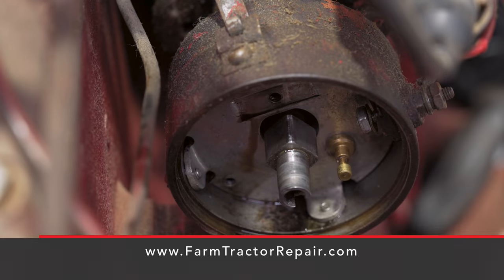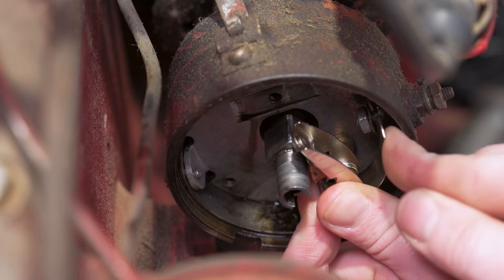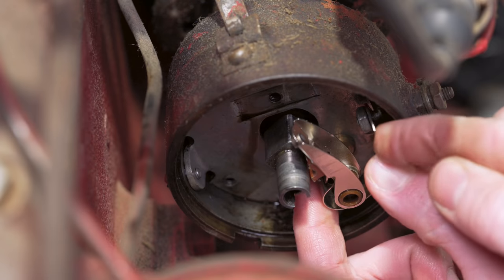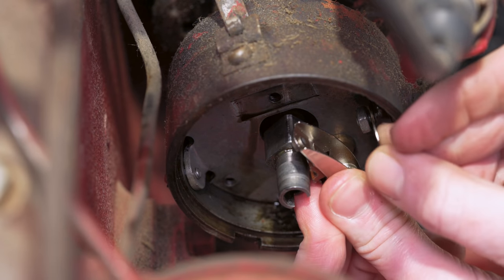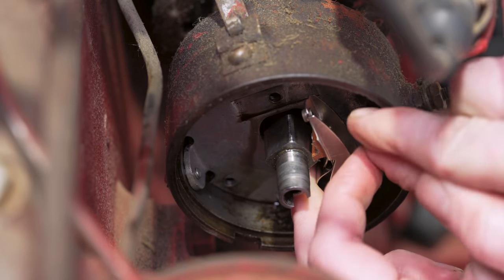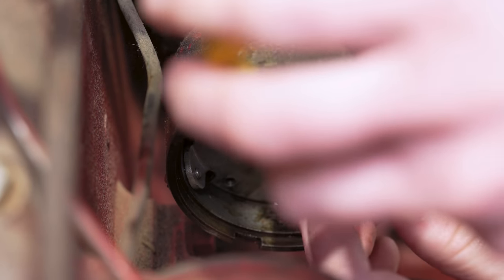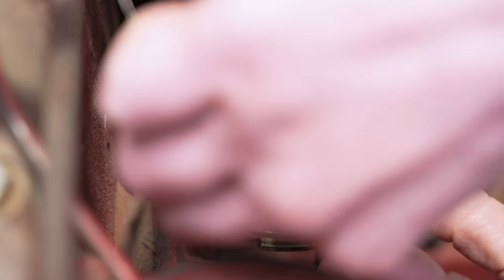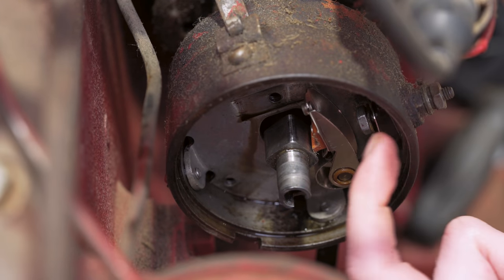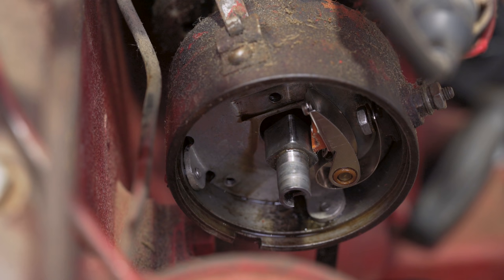I have just a touch of grease that I'm putting onto the shaft and you will want to do the same. Then you can put your new points in — I like to get it started onto the groove and then work on this tab and try to get that where it should be. Notice inside here there is a washer behind that nut and I like to get this in between the washer and the nut. So let me grab onto that prong with some pliers and slide it into place. Make sure that the washer is closer to this Bakelite — and that is how you install the points.